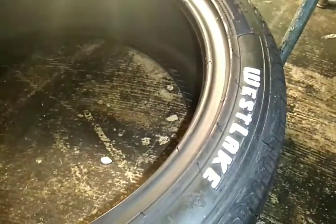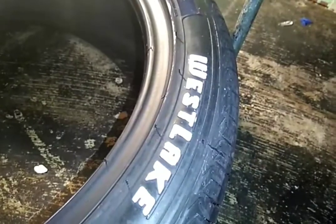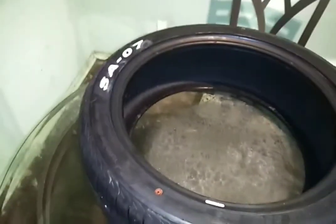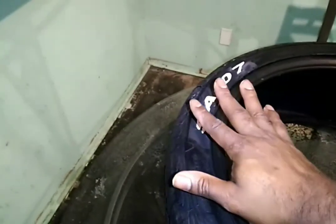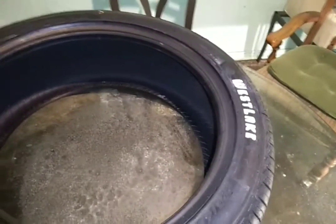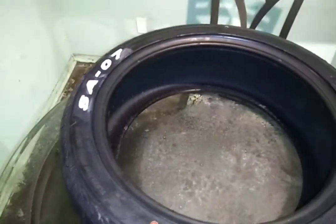I'm going to clean that up and then we'll see what the results are. I'm just going to let it sit for about five minutes so everything will dry, then I'm going to put in one more coat — coat number three — and then I'm going to clean everything up with the razor blade and we'll see how this thing turns out. And here's the result. Still got to clean up around it — I got a little dust you can see around it. This is still a little tacky to the touch so I'm not going to touch that. When this dries, I'm going to put some clear on it just to protect it and keep it from fading even more. But I think it turned out pretty good. Now I got to start on the second tire, but this pretty much is what I wanted.